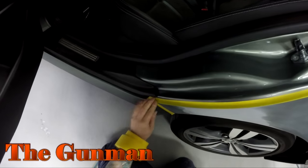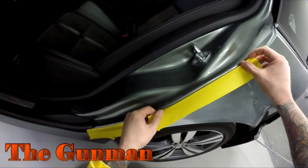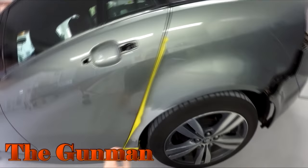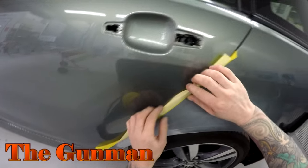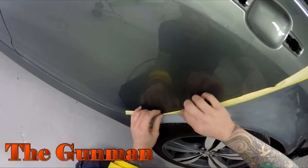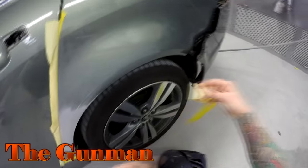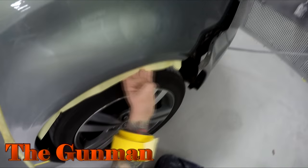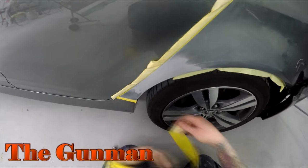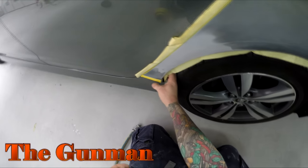I do prefer to properly back mask all wheel arches. Back in the day I used to just throw a bag over the wheel or throw a piece of paper over the wheel, and overspray would land up under there. These days I prefer not to do it. It'll actually keep your job cleaner — less chance of stuff from underneath that wheel arch flowing back into your paint, and you don't have overspray underneath that wheel that you've got to tidy up later. So it works best if you do back mask your wheel arches.